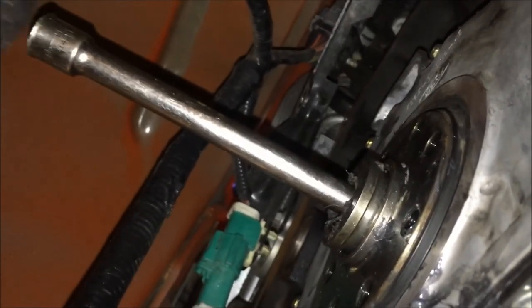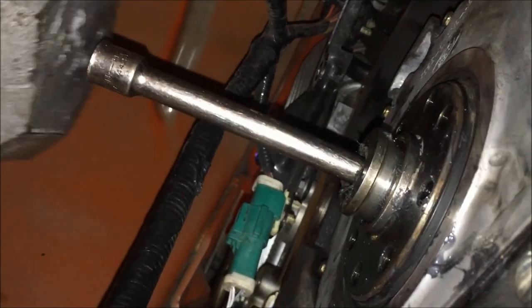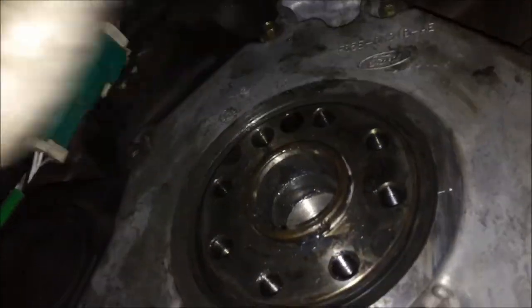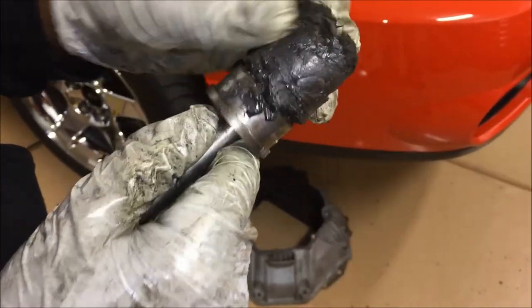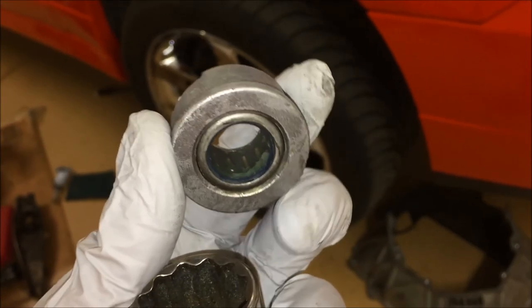Keep going — add more grease and paper as you pound this in far enough, and the whole pilot bearing will come right out. You're just left with a clean crankshaft. This is a huge wad of toilet paper and grease that we just kept shoving into the back of the pilot bearing — you just keep adding it and punching it in and eventually it will force that bearing out. All the toilet paper and grease goes in behind it and pushes the bearing from the back.